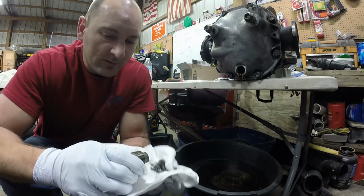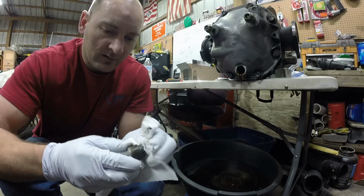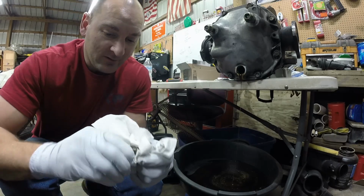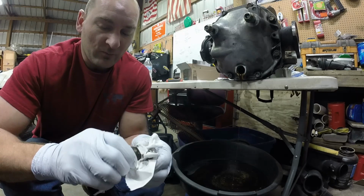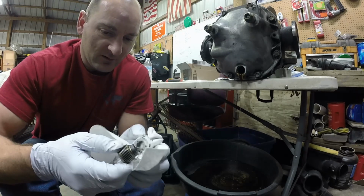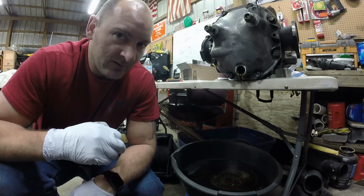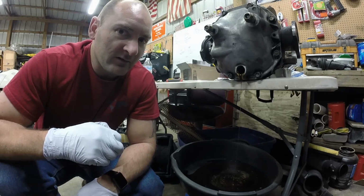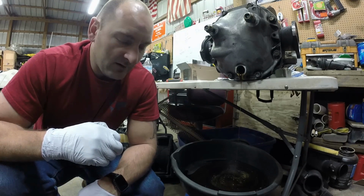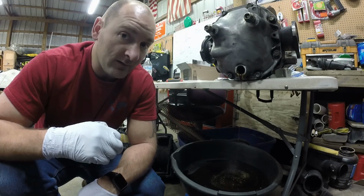I got all the hardware with it, even the axles, in case I need extra axles, but that's for another project, because this is going in the convertible and I've already got axles in it, so I don't have to deal with taking them out. And it's a direct replacement for the open diff in there. The only concern that I've read about is that this ABS diff from a J30 is just about an inch longer in the front than the stock open diff out of an S13 or S14 non-ABS.